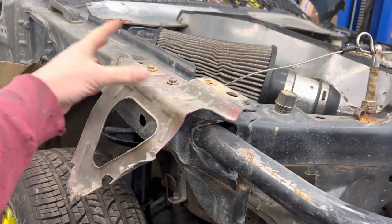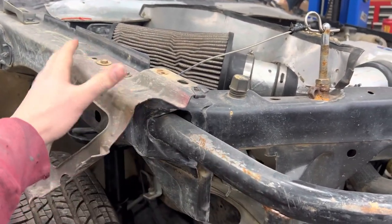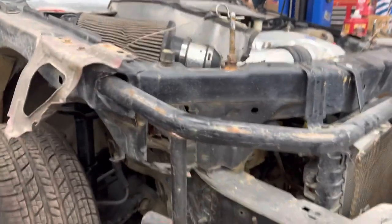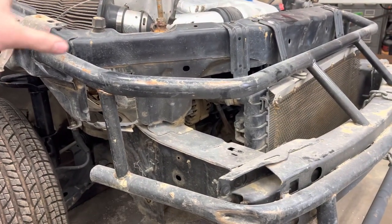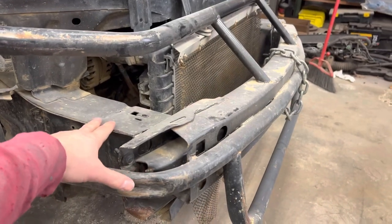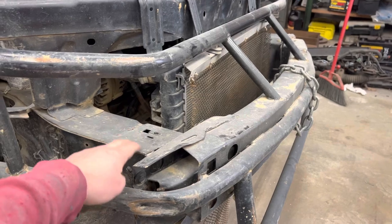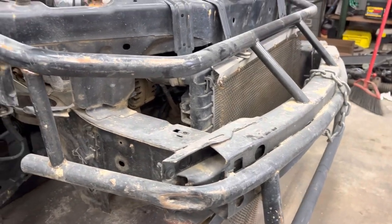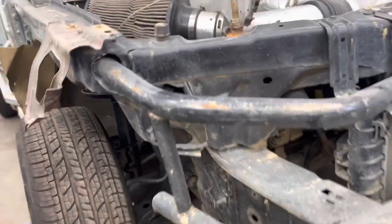the unibody. But this is all in front of the suspension point. So it took the hit, you know, and it soaked up the energy into the unibody. It soaked up the energy into the bumper here. It didn't torque the main structure a lot. These rails did move a hair, but I think we took a bunch of measurements. It's like less than half an inch they moved that direction with the hit. But again, in front of the suspension points, so not a problem.